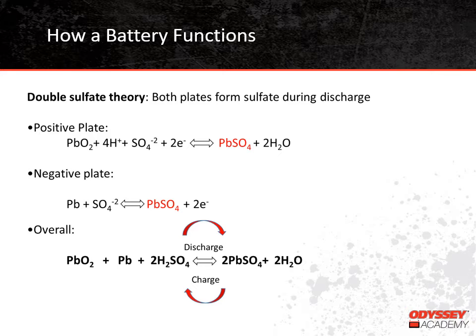Now we'll discuss how a battery works. We need two dissimilar metals to be the electrodes inside the battery. What we're showing here are the chemical equations for the positive plate, the negative plate, and the overall battery. The positive plate is different than the negative plate, so we have dissimilar metals. When those two plates are combined inside the battery, we have lead dioxide from the positive plate, lead from the negative plate, and sulfuric acid as the electrolyte. The left side of this equation represents a charged battery. When the battery is discharged, the sulfate from sulfuric acid attaches to the plates, leaving us with lead sulfate and water inside the battery.